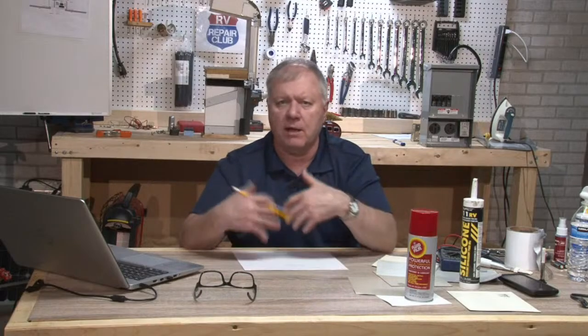You have to have a multi-stage converter that has a desulfation stage, because that's a big problem with batteries. Every time you drain the energy out of a battery, sulfur attacks the cells, the plates in your batteries, and coats them. The more cycles you go without breaking up that sulfur, they get sulfated and then they lose their capacity. That's been a big problem with lead acid.